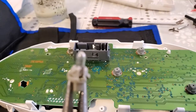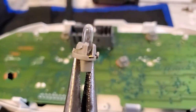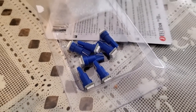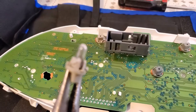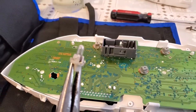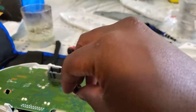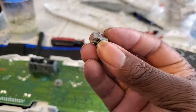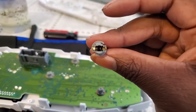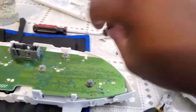These bulbs are 2721 T5 — that's the bulb size for this cluster — and I'm replacing mine with blue LEDs. I bought mine off Amazon and will link them in the description. To install the new LED, just pull the old bulb out of the socket with needle nose pliers, put your new LED into the socket piece, then twist it clockwise back down and you're finished.